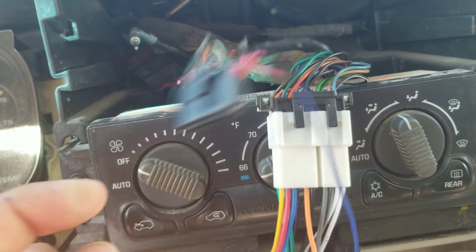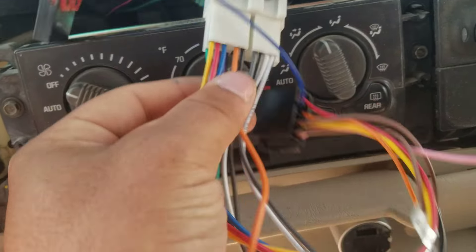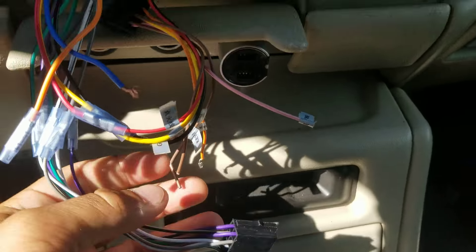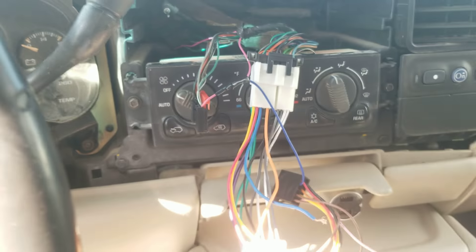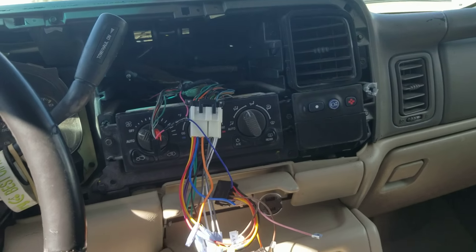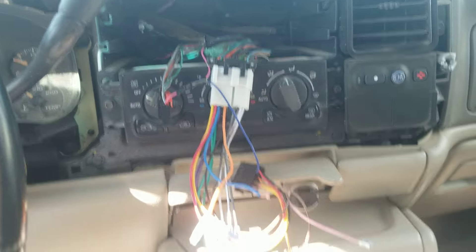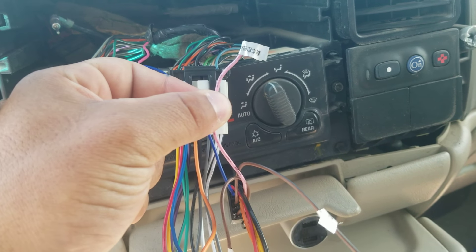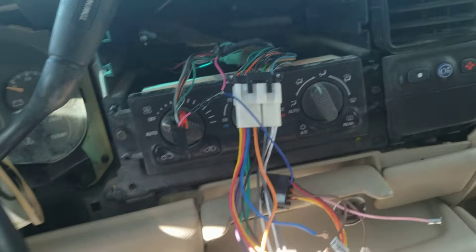So that's just a little update — blue wire to the pink wire on the extra connector, since that connector isn't going to connect to anything else on mine. Everything else connects to the main harness and those two go to the back of the aftermarket stereo. Easy as that, instead of spending 80 to 90 dollars on the kit. And for DVDs, connect the pink wire to ground — any grounded screw in there — and you can watch TV while driving.